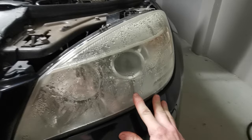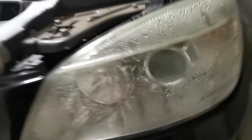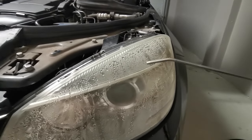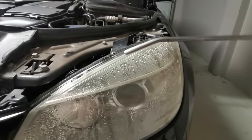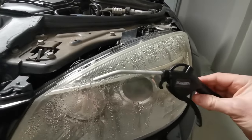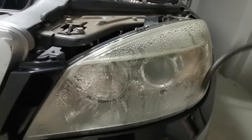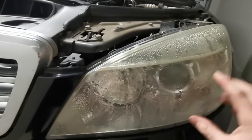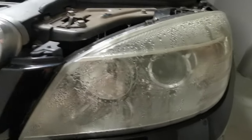There are a couple of very simple and effective ways to get this moisture out. I used to always use a compressor, compressed air, and a hot gun using tools like this. Opening a cap on the backside where the headlight bulbs go in, I would aim in and blow that air out — using a shorter pipe or one attached to it to clear it all out. I would use a hot air gun on the front, and the mixture of the cold air recirculating with the hot air used to dry them out and make it nice again.